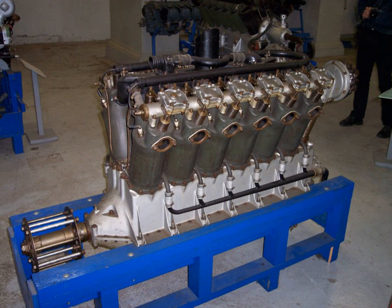The Liberty engine was a modular design where four or six cylinders could be used in one or two banks, allowing for inline fours, V-8s, inline sixes, or the V12. The design was held together by a two-part cast aluminium crankcase. The two pieces formed the upper and lower halves of the completed assembly and were held together with a series of bolts running around the outside perimeter. As was common for the era, the cylinders were separately formed from forged steel tubes with thin metal jackets surrounding them to provide cooling water flow.